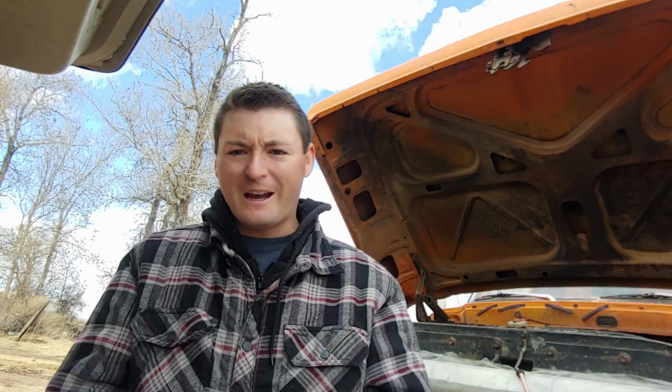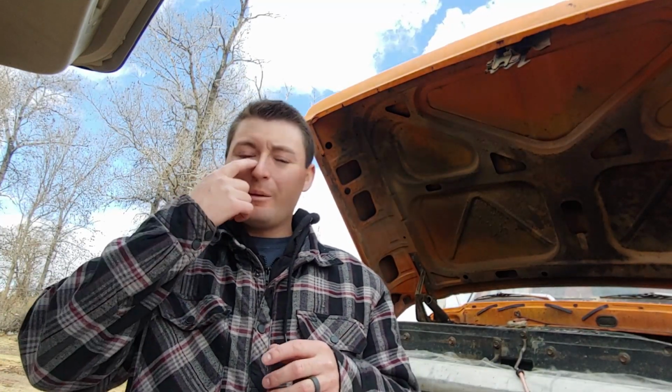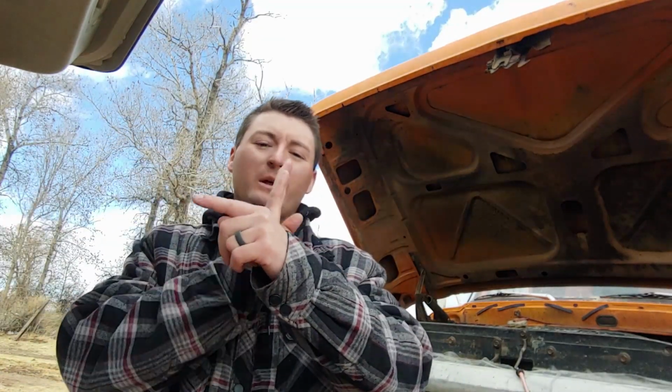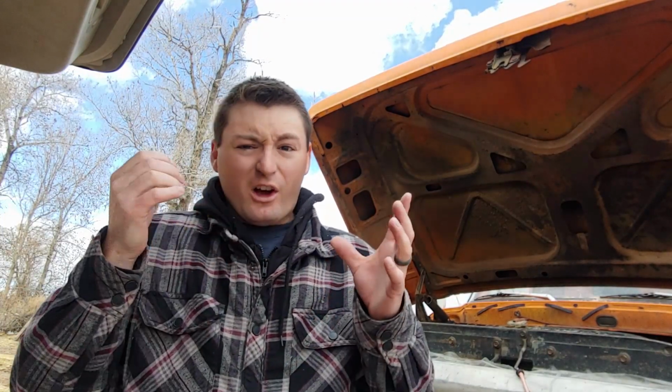And we're done. Finally. I will be honest, that was a rough repair. The top of the alternator has to go through 2 brackets, then the alternator, then a bracket, then a spacer, then into the block, and it's all really tight. So that's super hard to do, and it just took forever to get that on.